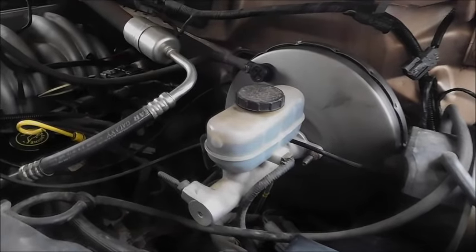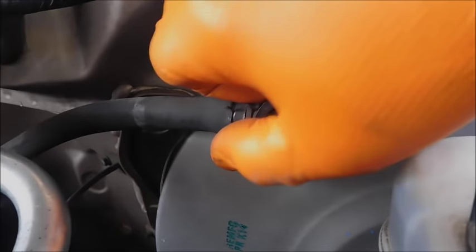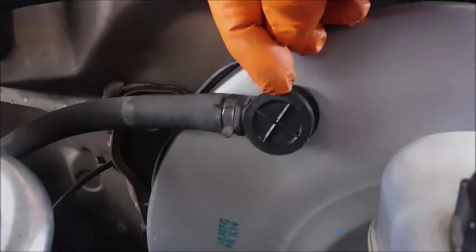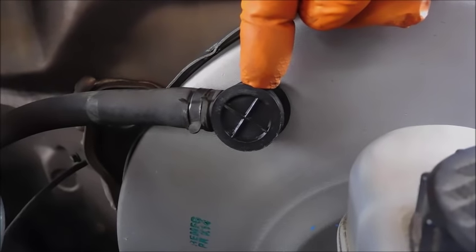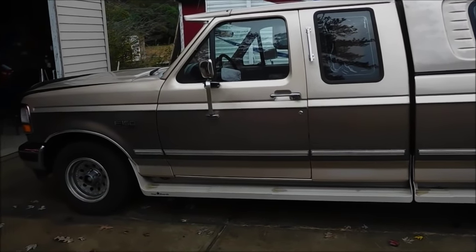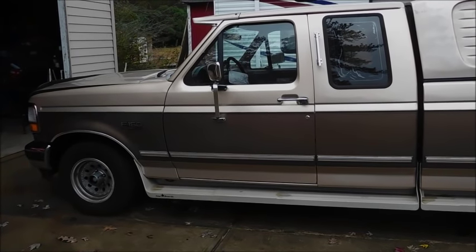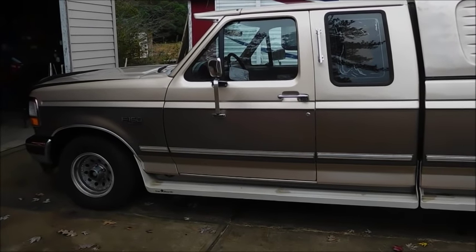The last thing I did was release the little clamp using pliers — squeeze it together and slide it down — then pulled the old check valve off the hose, since you have to use the one that comes with the new booster. Slip the new check valve onto the hose and reinstall the clamp. That job wasn't so bad. If you need to change your booster, it's a fairly easy one compared to some I've done. Thanks for watching.